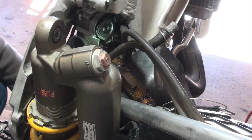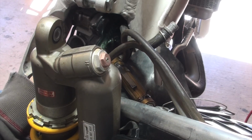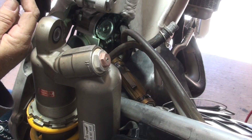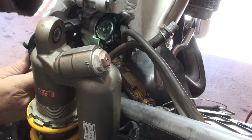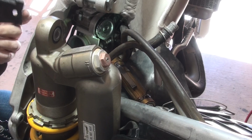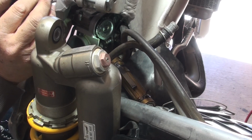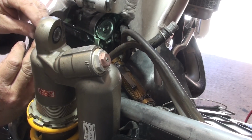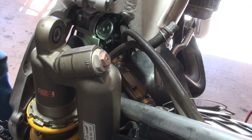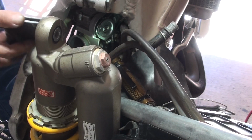Okay, more difficult stuff. So this is the plastic cover that goes over the throttle connection. There's these tabs here. It goes on the outside of the bracket or the, I don't know what you call it. And there's clips on the throttle, there's all types of stuff that you gotta be conscious of. There's also two screws here, if you saw me take it out. The first one, we're gonna hand tighten it, and then it's really difficult to get an Allen wrench in there, but we're gonna go for it, of course. And then there's one that goes back here that's pretty accessible. So let's first get this seated with the throttle cable connections and the clips to the manifold.